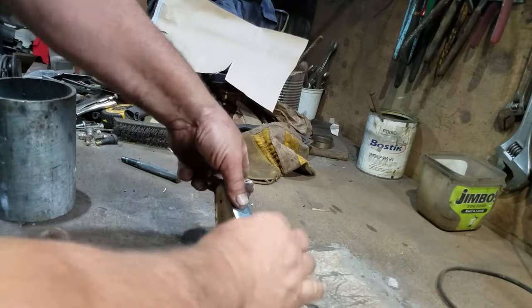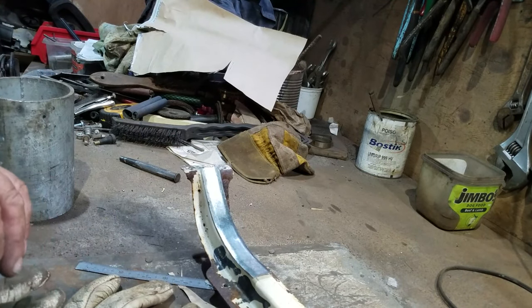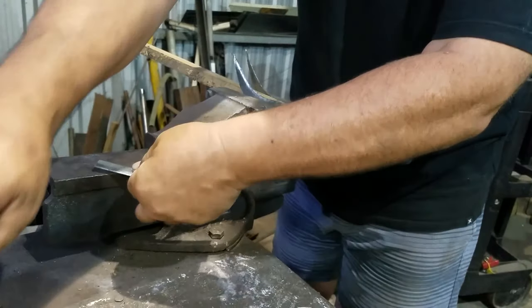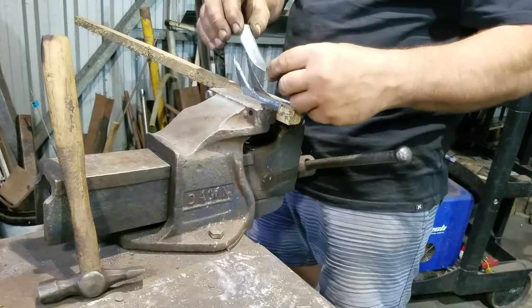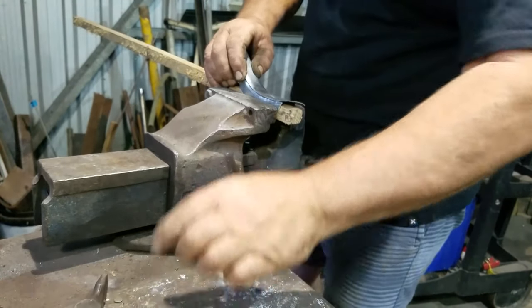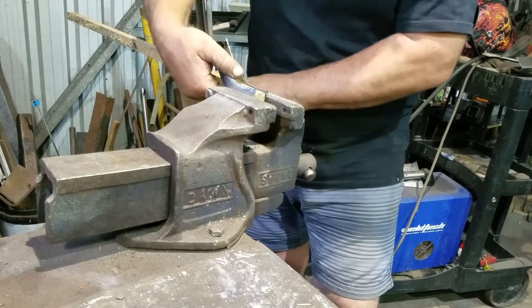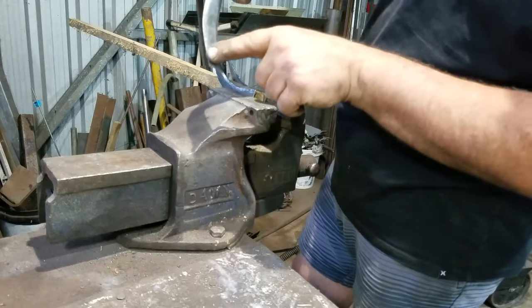I've got the beginning of my curve. I'm now going to push this curve into it and then set these up nicely and get some tack welds on them. These two points are my datums — that's what has to line up. I'm going to have to sneak three millimetres off the side of this and re-roll that line.